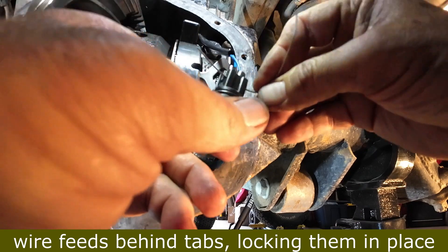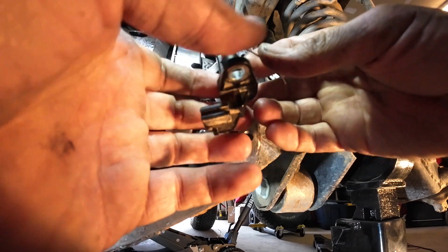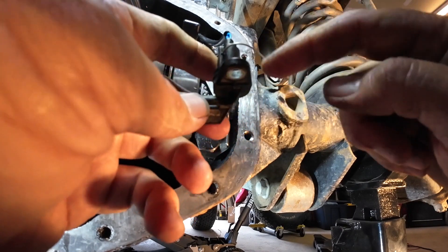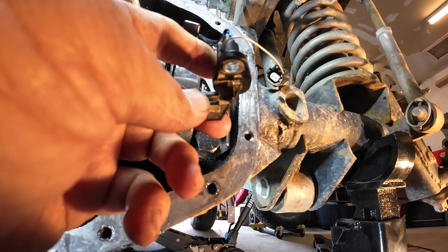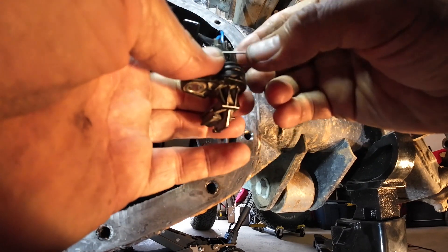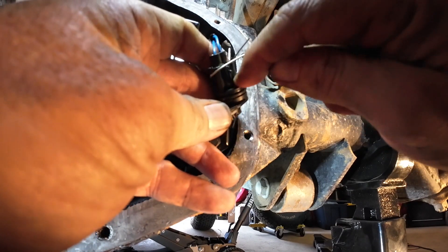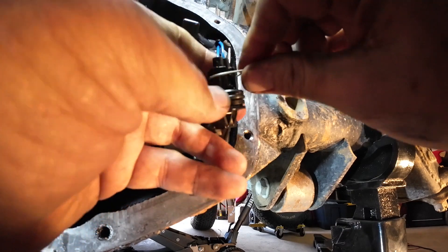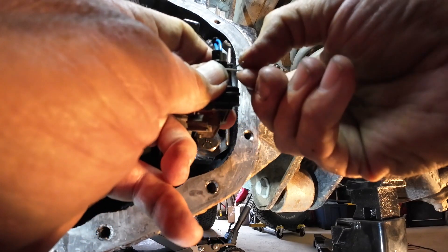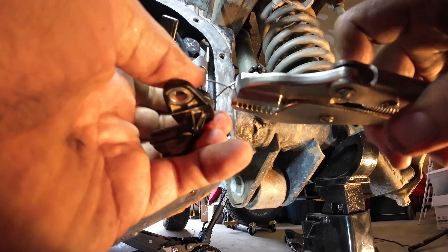It feels pretty secure but I can still pull it out, so the safety wire will go right behind here. I'll wrap it around this way and give it a couple twists. Is this going to come out and end up in my differential? I don't think so — it's just going to get bathed in oil, there's no motion. I've still ordered the part and I'll still replace it, probably the next time I'm in this differential. This is a 1/16th hole and 0.041 safety wire — the real stuff. I have safety wire twisting pliers but I'm just going to use my vice grips here.